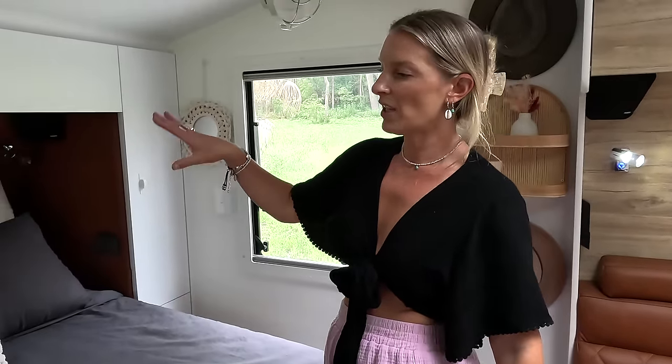I'll run you through a few things that Beck missed, eh? So it's mainly just the techie stuff that Beck isn't all around. So up above her right here is the Dometic. That is our aircon. That is a new Fresh Jet model. It's running at the moment, all off our battery system. They're really good. They're an inverter style aircon. There's only probably two or three models on the market that are able to run off an off-grid battery system with a low enough current draw. But anyway, that's good. We've had those before.